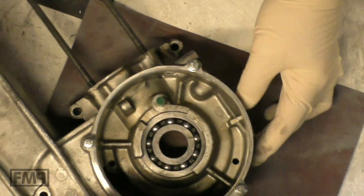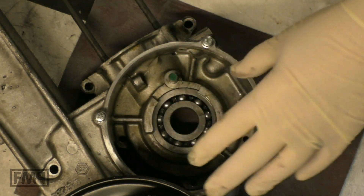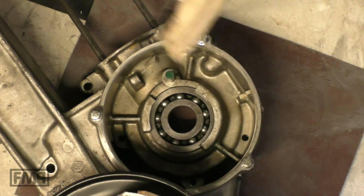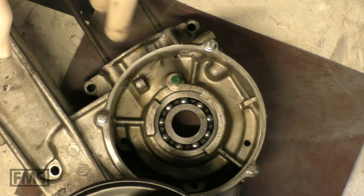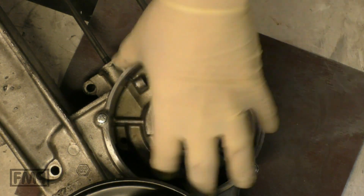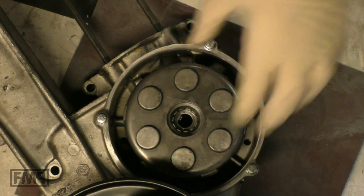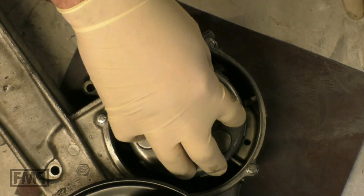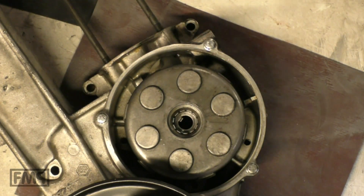What I want to show you is my assumption why there is no oil anymore under the clutch. This was just meant to be a 125 engine case — that's why the 200cc case still has the 125 ports. It just got bigger, and with that, also the clutch got bigger. Because the PX old clutch and the old one from the 60s — it was small. And what you can see here is that there was space between the clutch basket outer diameter and the engine case.